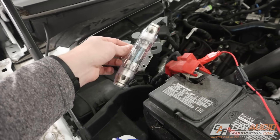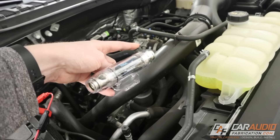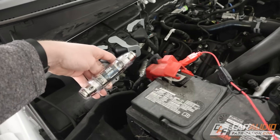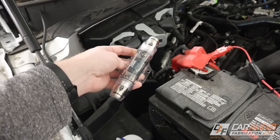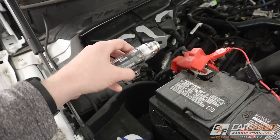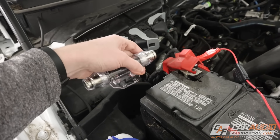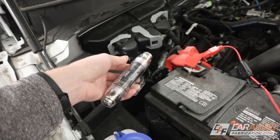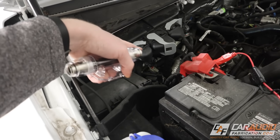I need to come up with a good location for this fuse holder. A couple of tips on things you should avoid: try to avoid being near the engine if possible, because there's excess heat associated with the engine. Secondly, you want to be as close to the battery as possible. There's a common rule of 18 inches out there, but I actually don't like that rule. What's more important is understanding that the wire between the fuse and the battery terminal needs to be as short as possible. The whole reason we add a fuse in the first place is not to protect the gear — that's actually a common misunderstanding.